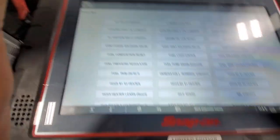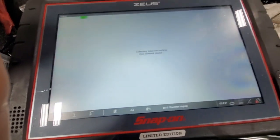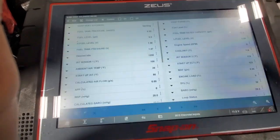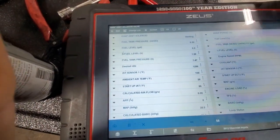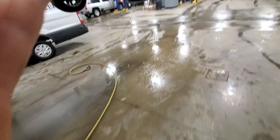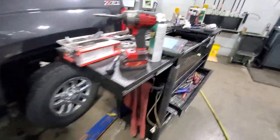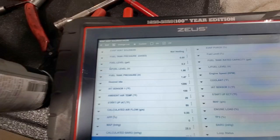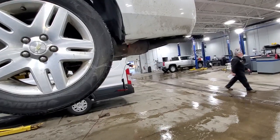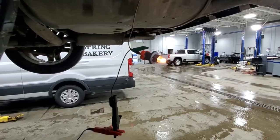Are either of my scan tools wrong? Which is a very good possibility. So let's command it on. Alright, when I switch this on, the driver in the computer is going to give it a ground. Let's turn it on. Okay — and no light. Let's turn it off. Fascinating. That does look like a lit light to me with the solenoid commanded off.